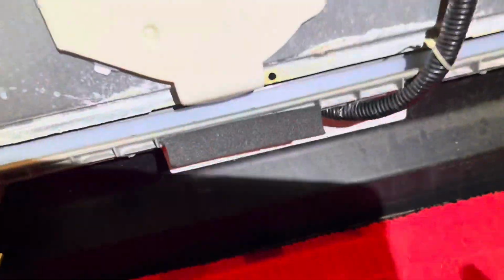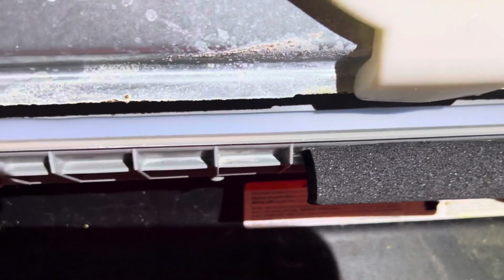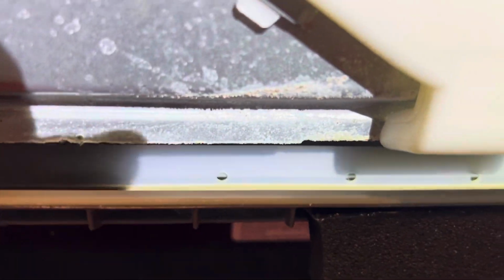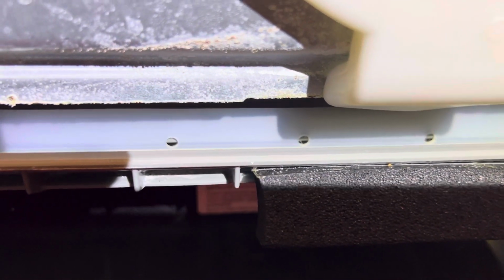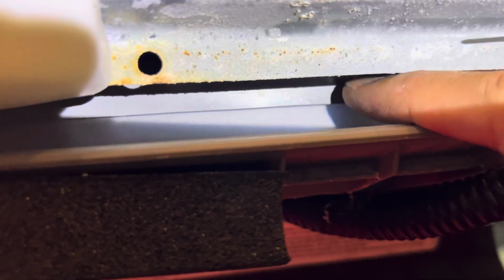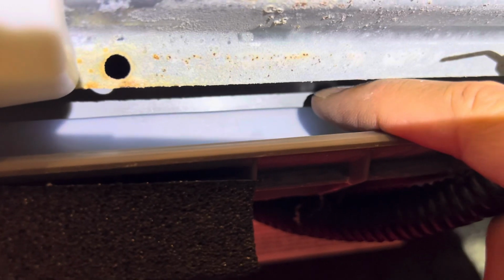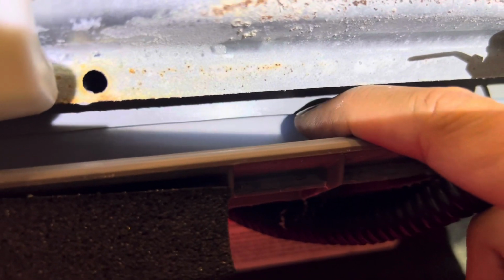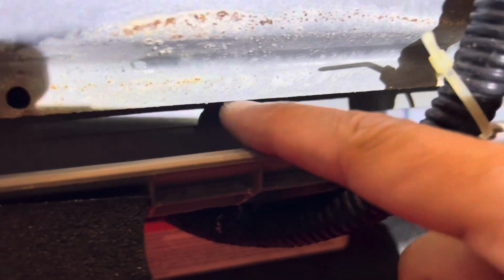What ends up happening is a couple of trial and error, so I just want to give you the details here. I think I made every possible mistake you can think of. This replacement gasket here with the holes in it was not seated correctly in this upper gray housing. This lighter gray here is the actual gasket. This is the pinch flap, if you will, that holds it in place, and it was not aligning to it. It had basically gotten loose on it, for both sides.